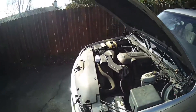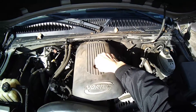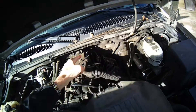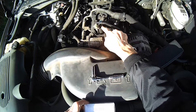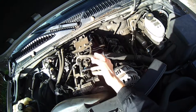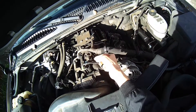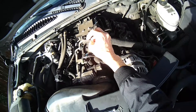Come to the front of your vehicle and use an 8mm to unscrew this bolt, then lift up on this cover and pull it towards you — these pieces come out of those clips. This here is called the vapor canister purge valve. It may be malfunctioning. What it's supposed to do is let some of the evaporative fumes that build up in your tank open up at a certain time when the computer tells it to.